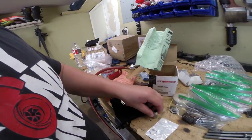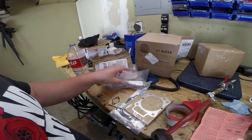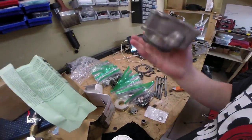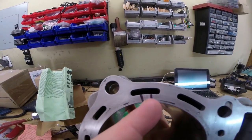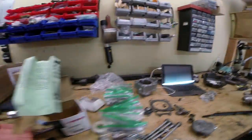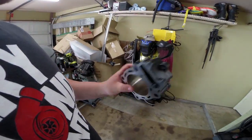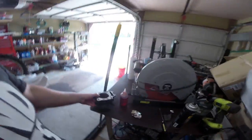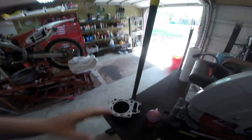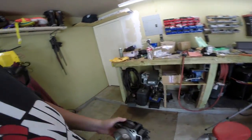It comes with a brand new wrist pin and a few new circlips, as well as new gaskets — a new jug gasket, new head gasket, new head bolts, and this is for the timing chain tensioner. I cleaned up the jug and you can see where it failed right here in black — there's actually a crack that runs all the way through here to the water jacket, and that is why our oil was full of coolant and vice versa. I bought this off of eBay, cleaned it up — this is just a nice new jug. All I did was use a little bit of ATF, a power drill, and some honing stones and went through and honed the cylinder. Now you can see it's got a nice little crosshatch pattern — it's pretty clean and it's going to work out just fine.